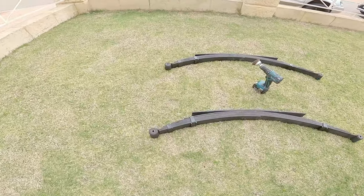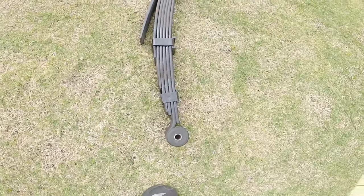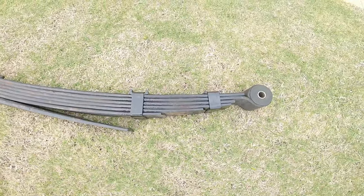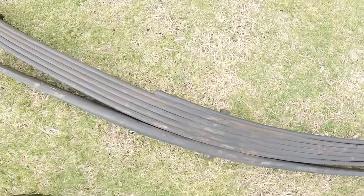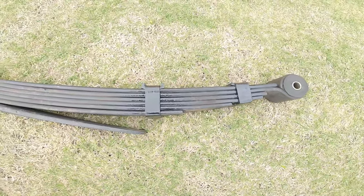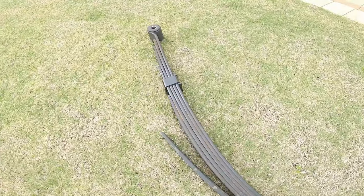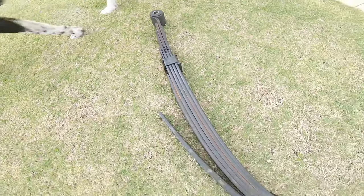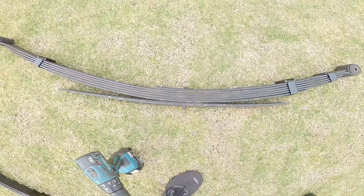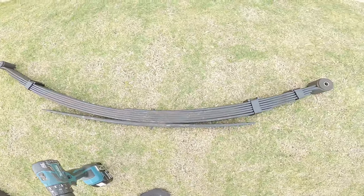Okay, so I've just returned from Ape Suspension in Wangara. They're the guys that reset my springs. They did a few things to the leaf springs. They put some clamps on for me. Two clamps at the front, one clamp at the rear. That should hopefully help with the axle wrap. The clamp at the rear was closer to the eye previously. It's now been brought closer to the diff. The helper leaf at the bottom's been bent up slightly, so that should help with the axle hop. So we'll get them painted up and chuck them in the car.